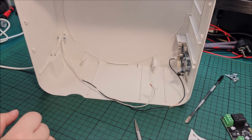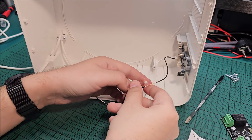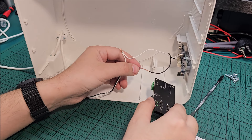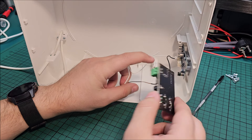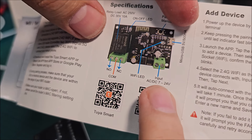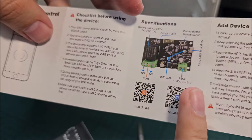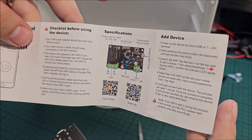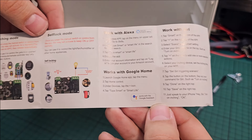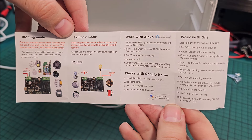You just go between the wires and slice it up, making sure you do not damage the wires — that's crucial. Now I can slide it in further with about this much more cable to work with. I made sure I know the location where I need the wires to go. They need to come in here because this is the wiring diagram. I need input from 7 to 24 volts — we have exactly 24. Feel free to pause at any time to read it, and also the back of it will be in more detail in the linked video.